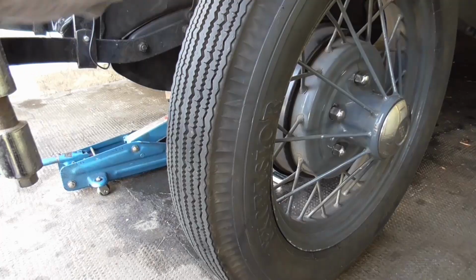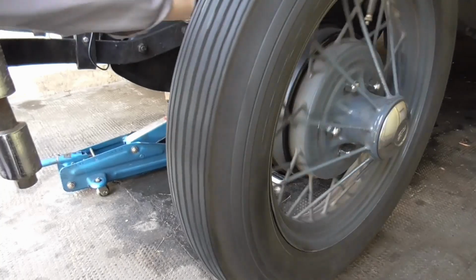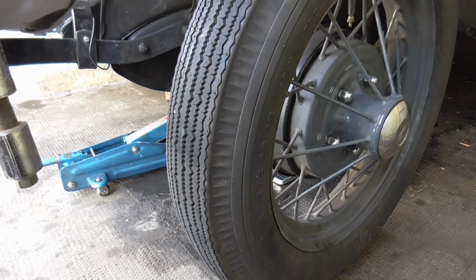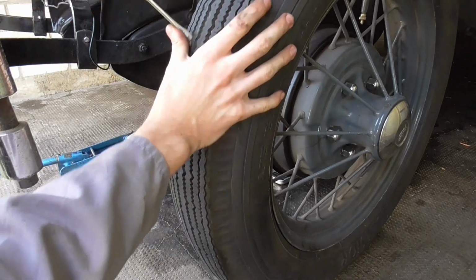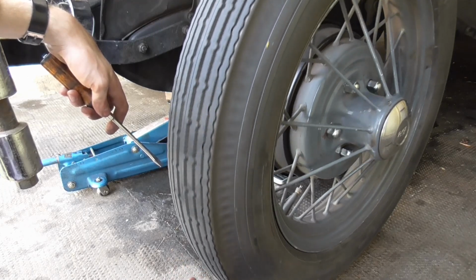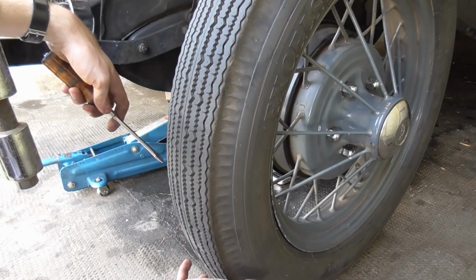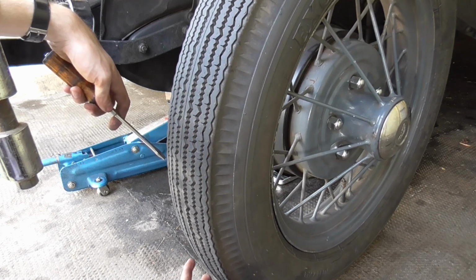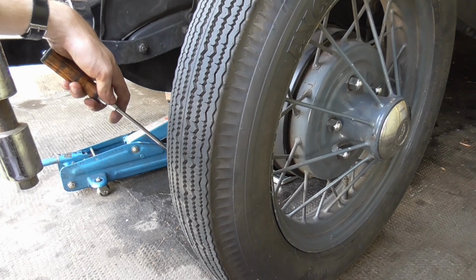Okay, so I've taken the brake adjust tool, aka wrench, and backed out the brake pads, so this wheel is now spinning completely free. And now with the tire mounted and making sure to eliminate all stones out of the profile, the wheel is now going to tell us where it is heaviest. This is not a high precision procedure, of course, but it's going to get the job done for the speeds that this is going to rotate at. And it seems like the heavy point is just about here.